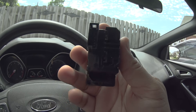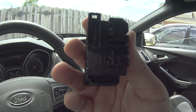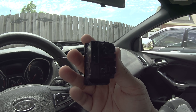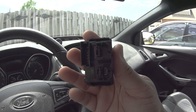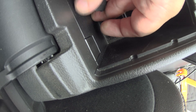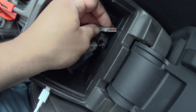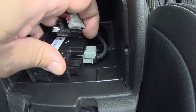I didn't get a shot of the bottom of the USB hub — this is what it looks like. These are the three plugs you transfer over. One of them kind of looks like mini USB on the inside. So you have these three plugs — a long one and two others — and you just make sure you transfer them over to the new plug the correct way. One of them is mini USB; you have one on the side with four prongs. It does have a little clip — just push this in and you can pop it out. For the long-shaped plug, the clip is on the side — just push that in and it comes out pretty easy.